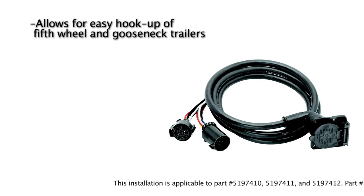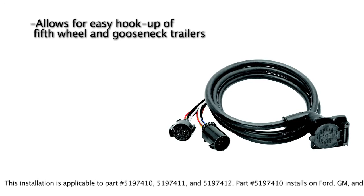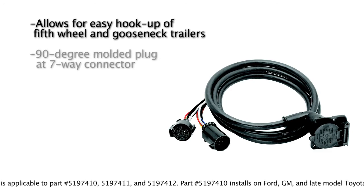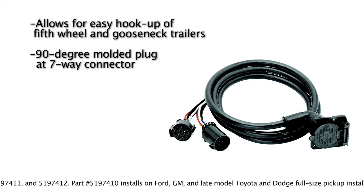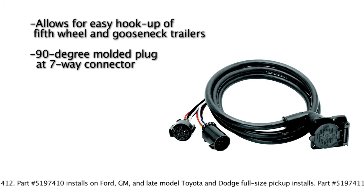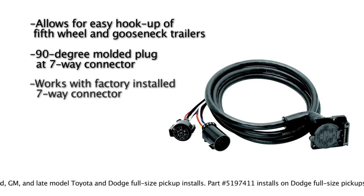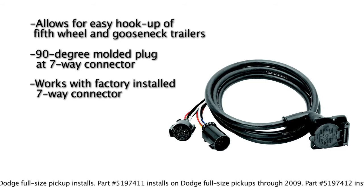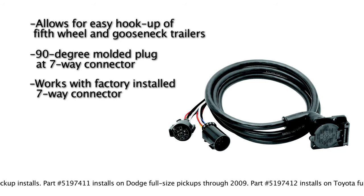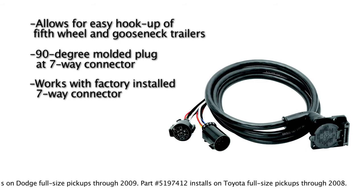One of the most notable features of the Bargman fifth wheel and gooseneck trailer 90-degree wiring harness is that it has a 90-degree molded plug at the 7-way connector to protect your wiring. The Bargman 90-degree wiring harness works like a T-connector with the factory installed 7-way at the bumper. You just simply disconnect the factory installed 7-way connector and then connect the Bargman 90-degree wiring harness into the system.